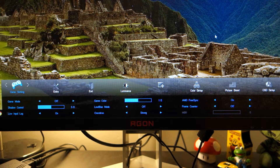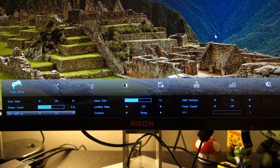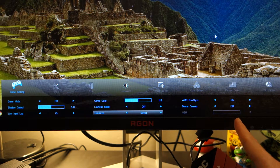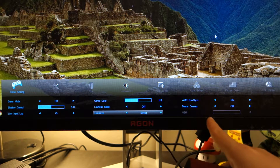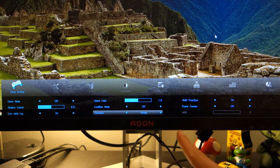The game settings are quite interesting. You can use the game modes but I personally wouldn't recommend them because they completely skew colours more than they already are. What I would recommend is definitely enabling low input lag mode and also customising the overdrive setting. You've got four options: strong, medium, off, and boost. Boost only appears when you have AMD FreeSync disabled. Similarly, MBR mode only appears when you disable AMD FreeSync — and that also applies to NVIDIA G-Sync.